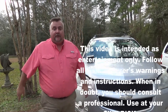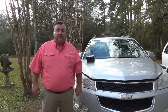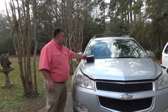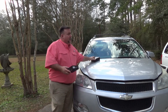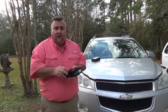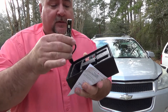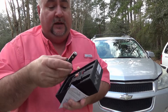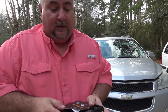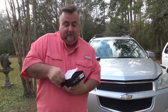Welcome to How to Infuse. Today we're going to take a look at how to change out the headlight. We have one headlight out on this Chevy Traverse - a lot of other vehicles are going to be similar. One difference about what we're doing today is that we're going to go ahead and upgrade these with some LED kits. I got these on Amazon and they replace the original style bulb with an LED. It has a little fan on the back to cool it and the stock plug, so it should be pretty straightforward. These should produce a really bright white light - you know those cars that you hate when they come up behind you? Yeah, well payback.